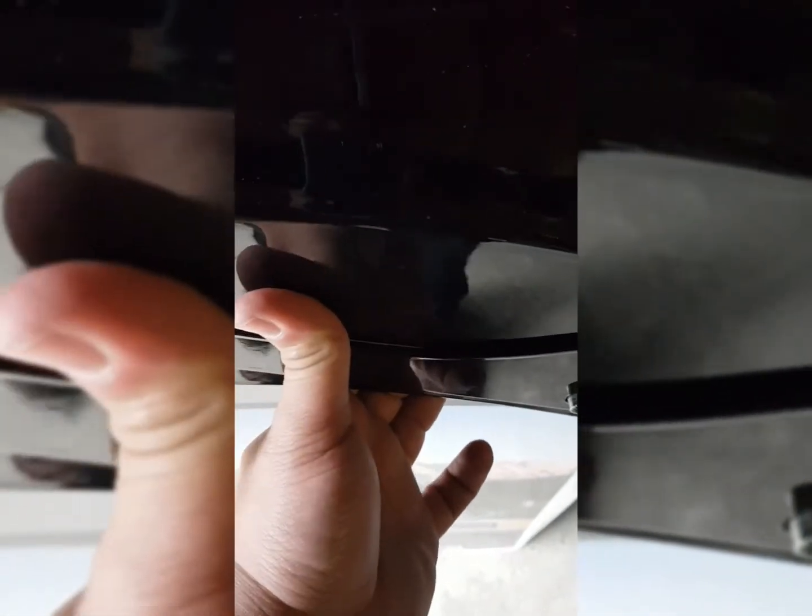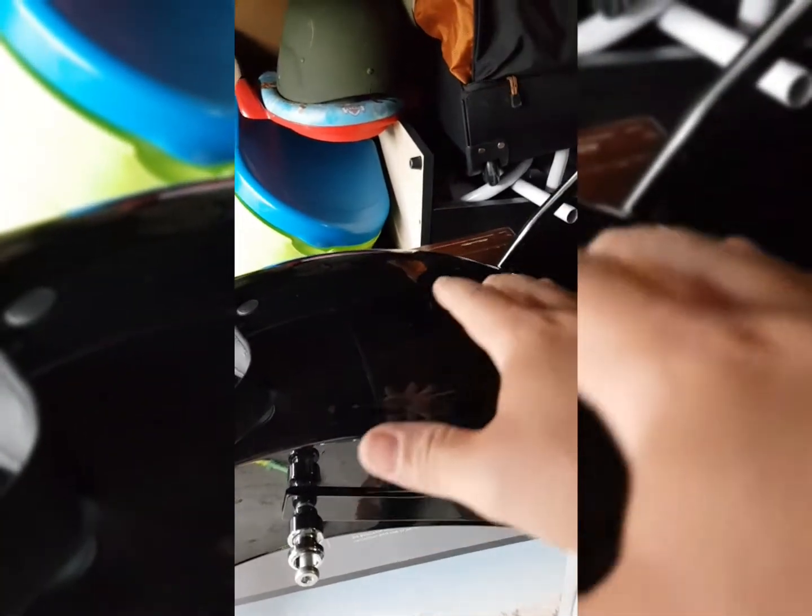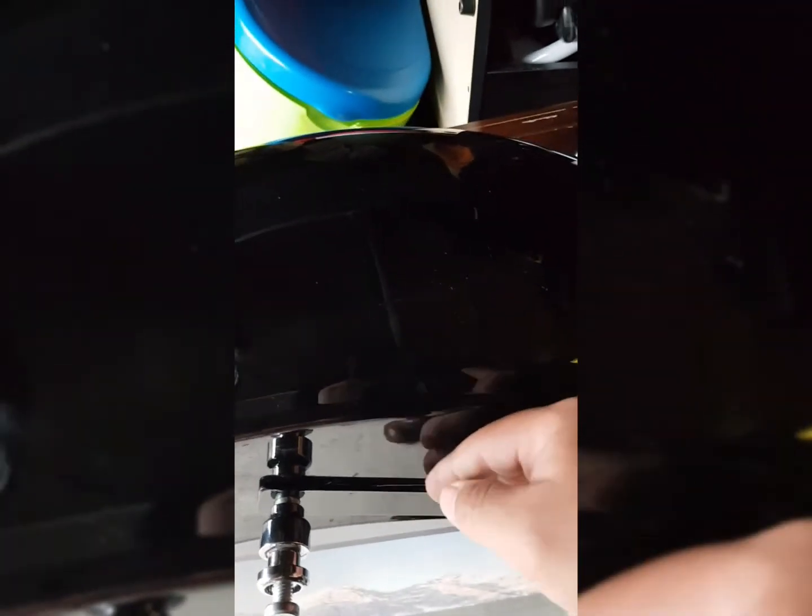Also, one note before: because these brackets weren't wide enough, it was scratching up my paint and will squeeze your fender, so you have to kind of muscle it, pry it open while you're slipping it over. Honestly, it's easier if you slip it from the back right here and slip it forward to the holes. I found that it was a lot smoother like that. But regardless, you have to kind of muscle open the brackets so they'll stretch far enough to fit over the whole fender. I put a piece of Scotch tape on the inside so it wouldn't be such hard surfaces rubbing up against each other, and it made the sliding a whole lot easier. Should have thought about that in the beginning with masking tape or something, but that's how it goes when you're tinkering with stuff.